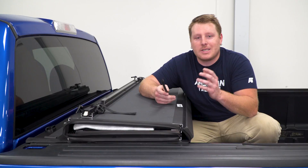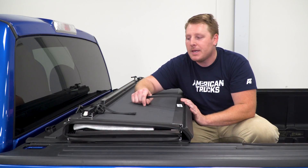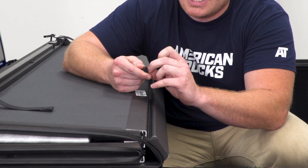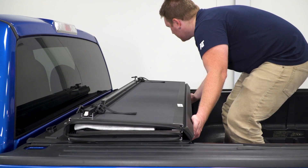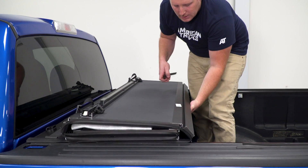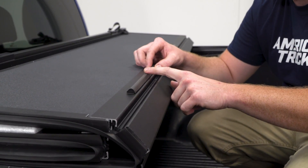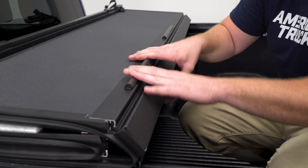While we're up here, we're going to install these bumpers. BAK provides you with these bumpers and they stick on right here on this edge. This is for when you flip the cover all the way up and attach those buckles — if it does contact the glass, it's not going to break it. Peel the backing off and start with the middle one. Release the cover, flip it up, get an idea of where you want the bumpers, lay it back down, and then place the bumper. Do both side ones as well, pressing down firmly, making sure the surface is clean so they stick.